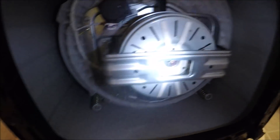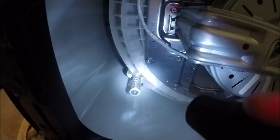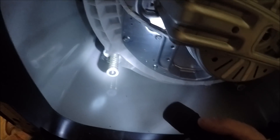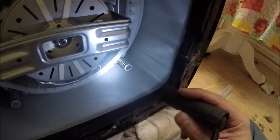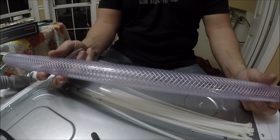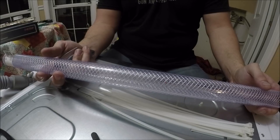Once the washing machine is on its side or on its front, you can see the drum assembly. The issue is that these springs are not strong enough to stabilize the drum. To fix the springs, there are a couple ways to get to them — you can either do it from underneath, which is what I'm going to do, or you can take the top off and the springs and rods will come out pretty easily. I'm going to leave the springs and rods in there. I went and bought this braided vinyl hose from Home Depot — you can use a heater hose or any type of hose. This one has a one-inch inside diameter; it might need an inch and a quarter, but that's fine.